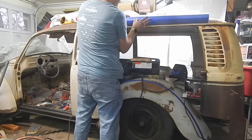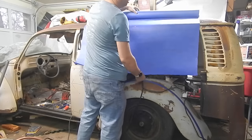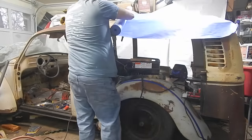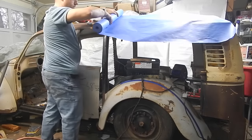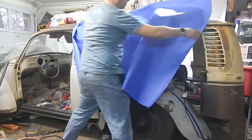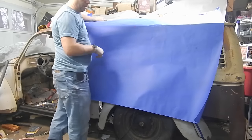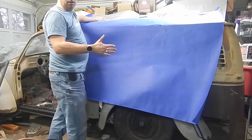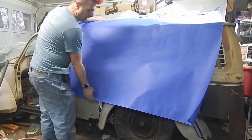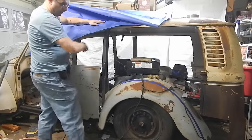I've got this big old sheet of blue roll paper that I've had forever. I think what I'll do is make a template and cut it out. I'm sure you've all seen this before — trace it in paper or cardboard. I saw my short earlier this week about my CAD work; well, this is part of it. This is not cardboard, it's a pad I guess. So the idea is that you trace it out, match it on the metal, cut it out. I want to go right above that bead line and then fill in this hole.